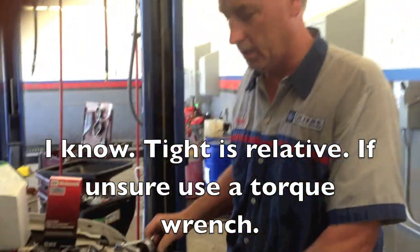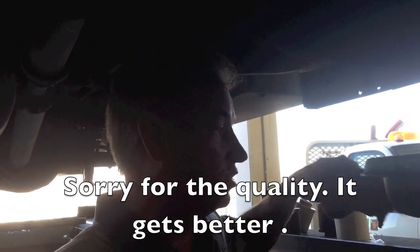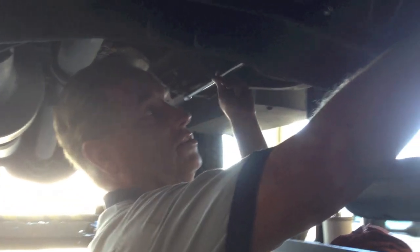Now let's go to the lower filter. The lower one has a few different options depending on whether it's two-wheel drive or four-wheel drive. If it's two-wheel drive, I'll use the same socket with a small one-inch extension on it — the 36-millimeter — to get right up inside there. If it's four-wheel drive, I have a 24-inch extension that I put the socket on and reach up behind the transfer case to remove it.